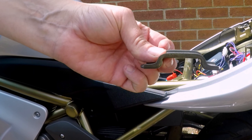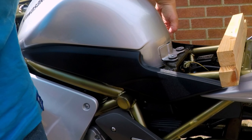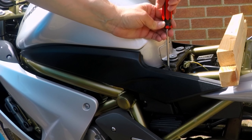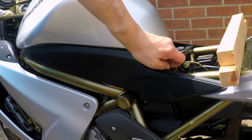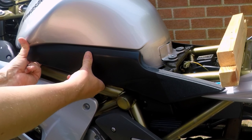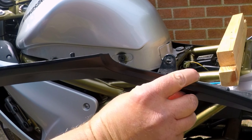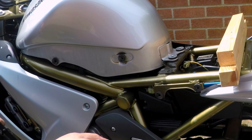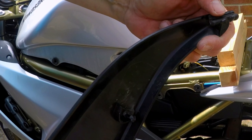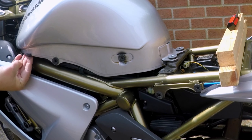I've just got to take the side panels off first. There's one screw right there — you just need to take that off. Then all you have to do is pull towards you, away from the bike, and it will come straight off. Just be careful because there is a rubber grommet at the front which caps onto the bottom of the tank to prevent rattling. There are just a few plastic nubs that go into some rubber grommets — they come off very easy and go on very easy, but they hold nice and sturdy.